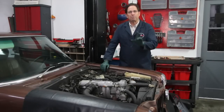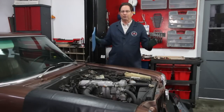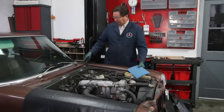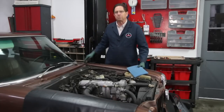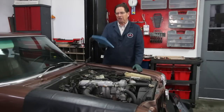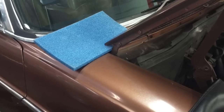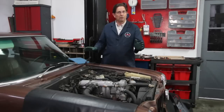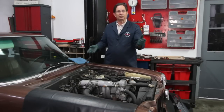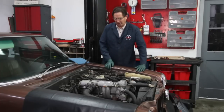Not when you consider how much time you will save when you do this type of work. Just a quick pointer: when you do take the hood off, always use a helper. Never try to remove one of these hoods yourself. The most critical part are the corners — when they drop, they're going to hit right here on this cowling or on the outer part of this fender and you're going to end up with some dents and some rather gouged paint. So as a safety precaution, get a couple pieces of dense foam and shove underneath the two corners of the hood. Get all the bolts loose, take all but one out on each side, then get your helper on one side, you get on the other, and lift the hood free and clear. Put it in a safe place so it doesn't get beat up while you're doing all this work.